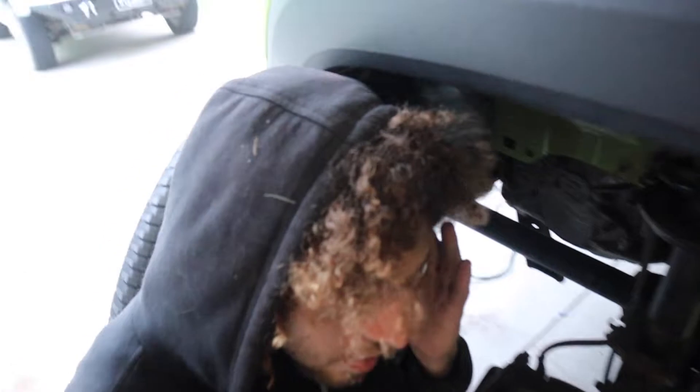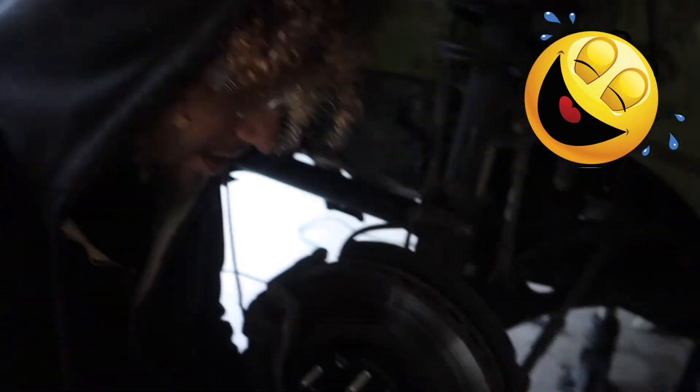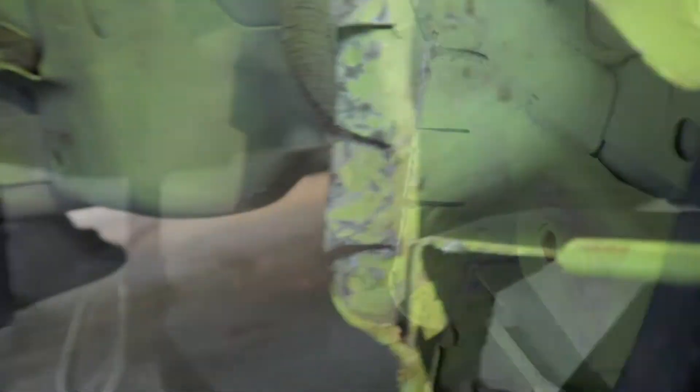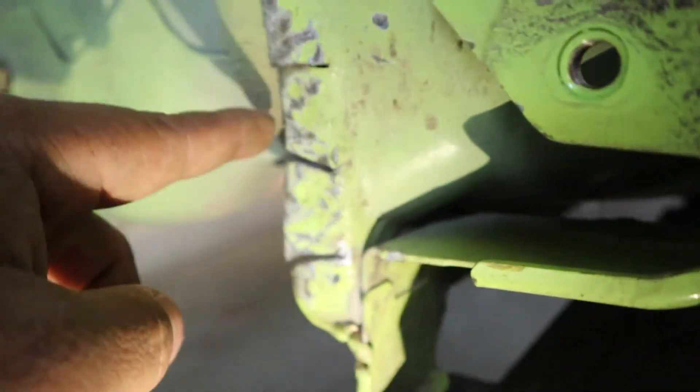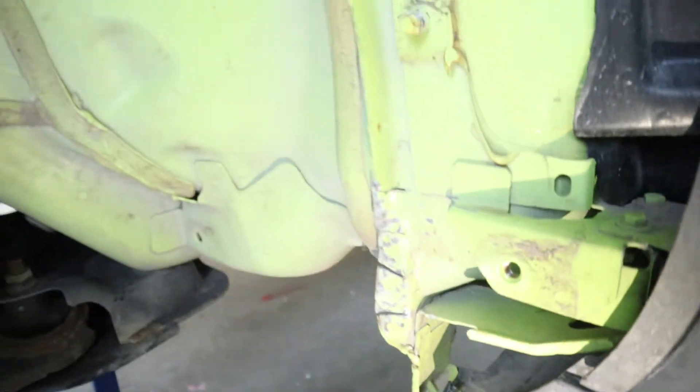Remember when you're grinding, use protection — and yes, do use eye protection. Don't let the sparks go in your face. We cut out some grooves or notches in here and we just smacked it over. Simple as that.